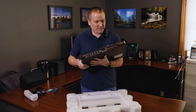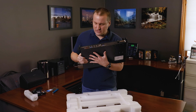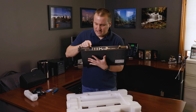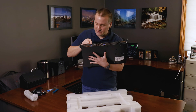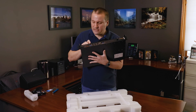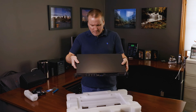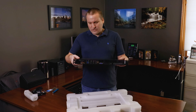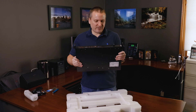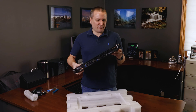There's actually a PCIe slot here, so I can add more ports or something in the long run. There's also USB, VGA, and this one here I think is a gigabit management port. I believe it's a 10th generation Supermicro management interface — an HTML-based admin interface that allows remote KVM and so forth.